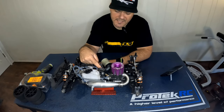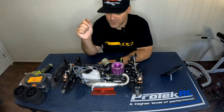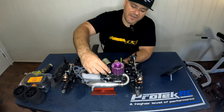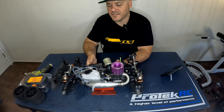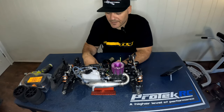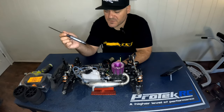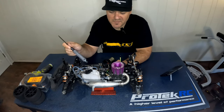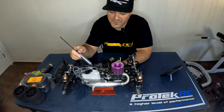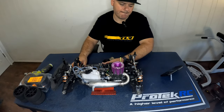The transmission, like I said, is pretty easy to adjust. It has two bolts. They're 2 millimeters, so you have to adjust those. The linkage, you can just refer to this video, I guess, and look at the way it is oriented. It's kind of simple. So you get your servo horns, plastic for the throttle, aluminum for the steering. I thought it was pretty nice. An inline filter. I'm not a fan of those because if you have a clunk filter in the tank, no need for this. But it's nice of them to put it there.